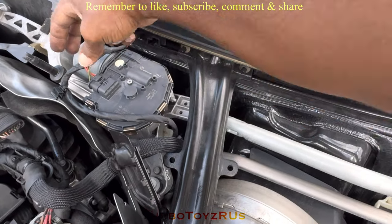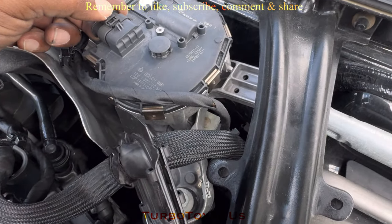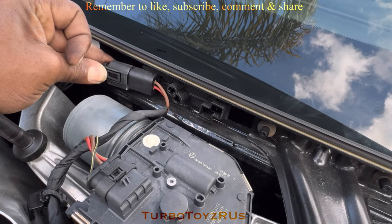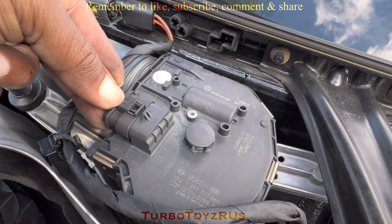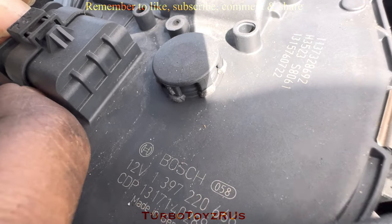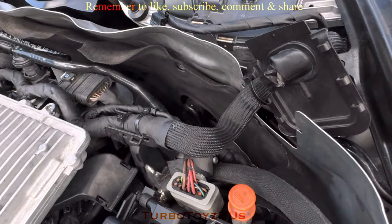In this harness, I'll be able to unplug it here. You are going to depress this clip — be careful with them because sometimes these things crystallize after a time. Here's number one, I'm going to depress it all the way and slide it off. Press the back portion there — it does the lifting — and you'll be able to slide it off. The harness is free now.